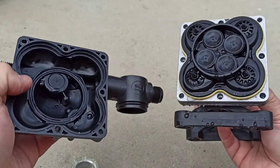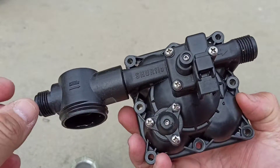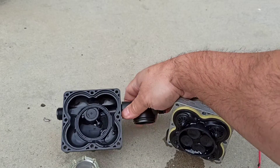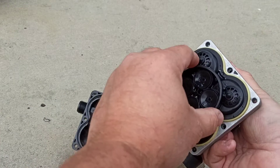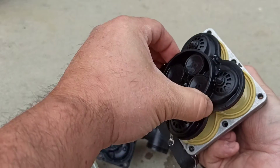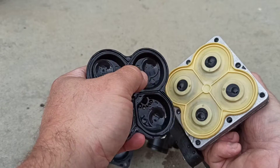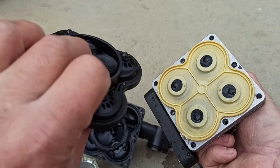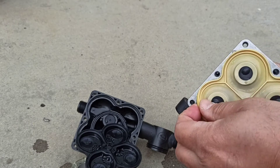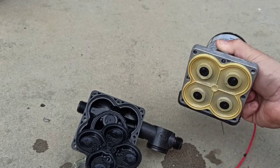When you take this off, you should have some water that spills out. The problem I was having was that water was back-flowing through the pump into the fresh water tank of the RV. Sometimes that can be caused by debris in the pump, so I'm going to take this all apart and clean it. The black separates from the yellowish section. Go through with a soft-bristled brush and gently clean any buildup or residue. You can also use high pressure from your sink. This section also comes apart, but I'm going to leave that on for now.